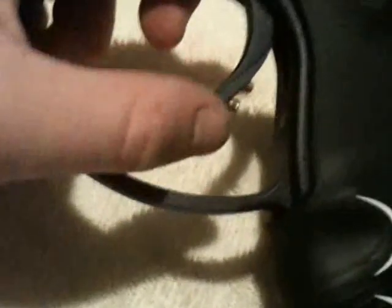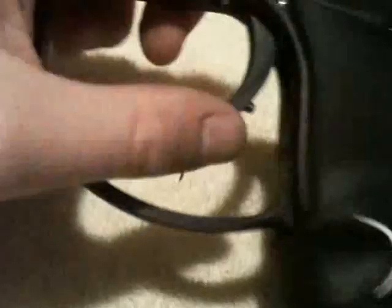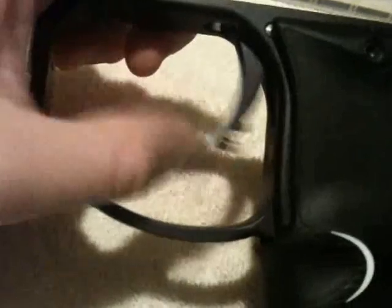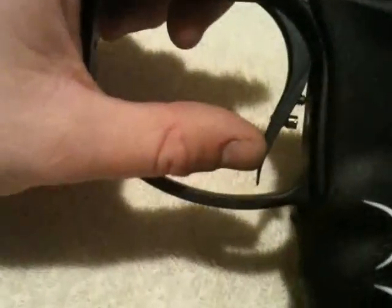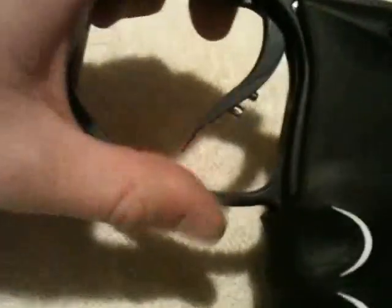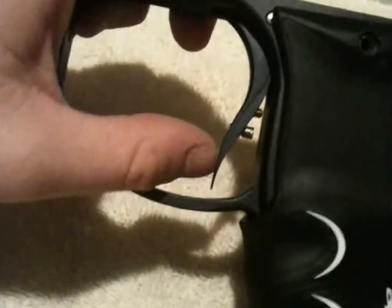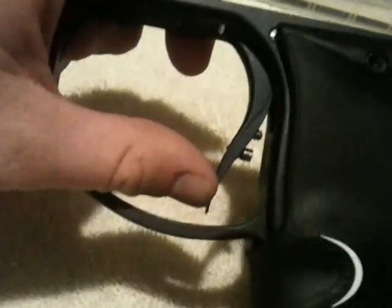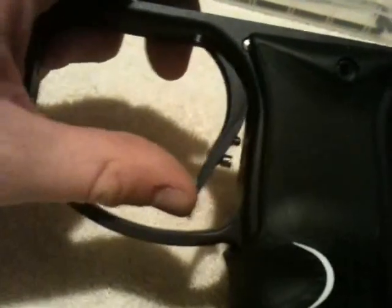Now of course with the magnetic return — this is the kicker. You don't really need this on here, but I like it. You can actually take this off and with the micro switch alone it's going to spring pretty good. I did that with my Bob Long 2K5 Intimidator and it worked great, but surprisingly this magnetic return actually works really good. I say leave it on, you're not going to have that much issue with it. If you have it at a pretty good distance like I do, when you pull the trigger it's just going to spring right back out just like that.